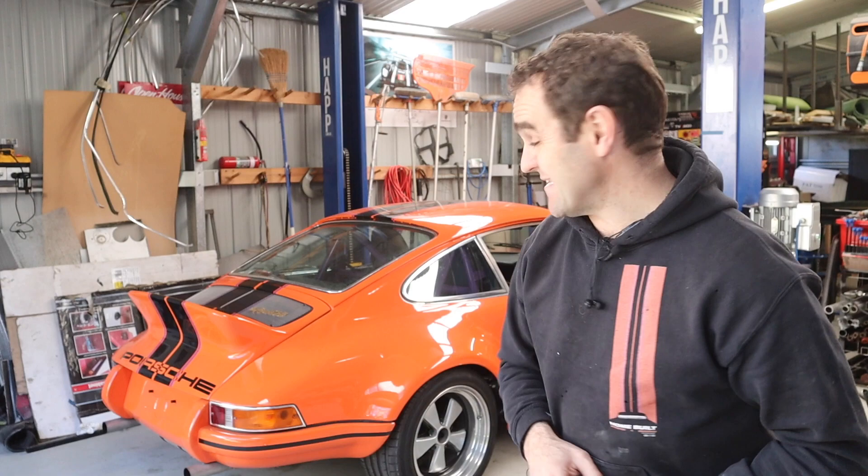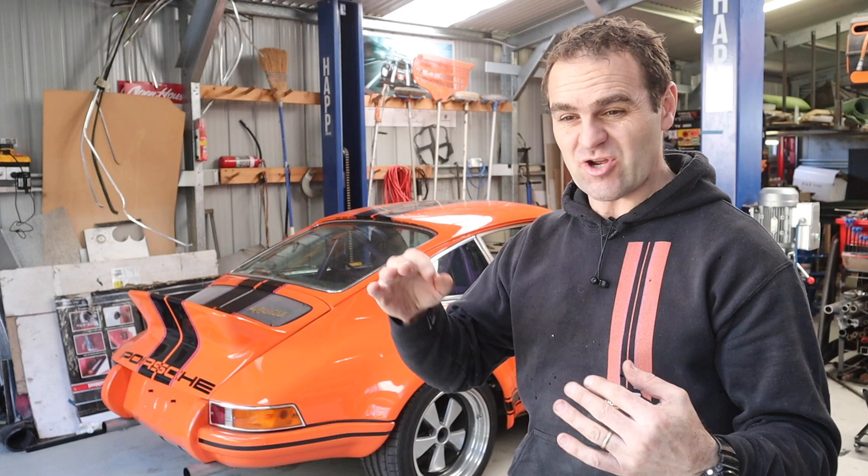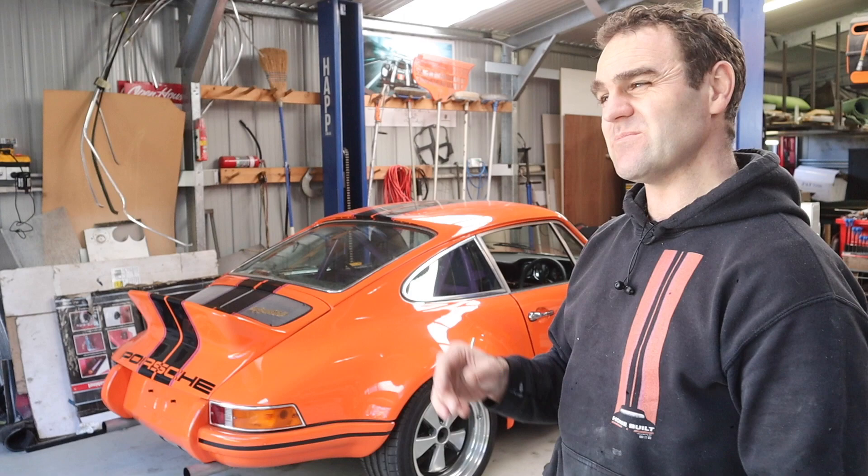As you can see, that's running so much better. It'll start now with zero throttle input, but when I first started it it was struggling to idle a little bit. The second time I started it with a blip of the throttle it just sat nice. Sometimes when I give a blip of the throttle it still seems to hang up at a higher idle for a while, so there are a few little bits and pieces that need tweaking. Either way, I wanted to start it so I can move it out, give it a wash and a clean, and move forward on the next thing.